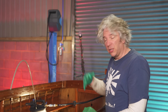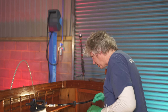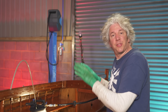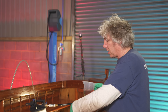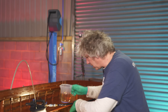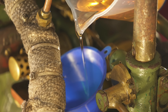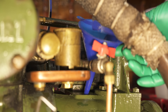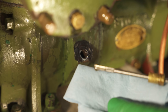It's absolutely the right thing to do to drain and change the oil because it actually reeks of fuel, and that means it's going to be much thinner and therefore won't be protecting all those mechanical parts. To refill the oil, there's a little port on the top of the gearbox and that's also going to help fill the chain case inside there as well. So basically everything will be nice and protected, and the oil I'm going to be using is 30-grade — it's just the standard thing you'd have in an air-cooled Volkswagen or for almost many machines of this particular era — and it takes about a pint. So here goes. Now let's check the dipstick — spot on. Lovely. So we now have our fresh oil in the gearbox.